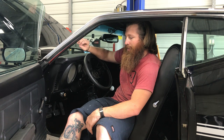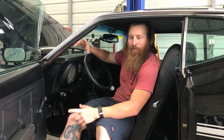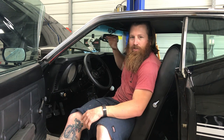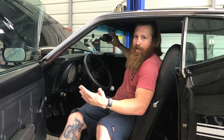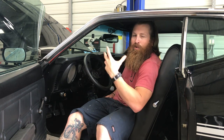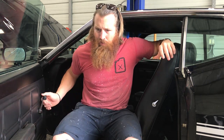If you've ever driven a 71 through 73 Mustang with a sportsroof like this, you will notice that you cannot see out the back window, especially with the louvers on. The guy I got the car from had the louvers but never put them on — he said he couldn't see out the rear window. So what I did is I actually installed a backup camera in the mirror itself. I hit a button, it turns the backup camera on, and I can see behind me with no glare. The reason I put it on a button is because at night I don't want it flashing in my face. This car is also equipped with 73 convertible rear windows — in 1973 the convertible rear windows were electric, so I converted the rear windows to electric. Now when you roll the front window down, you can also roll the back window down. There's no pillar there — it makes for a very clean look.